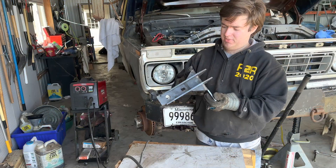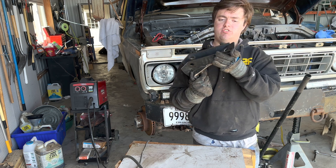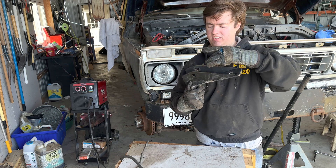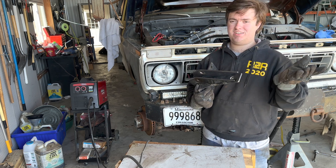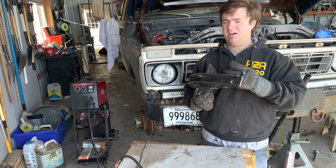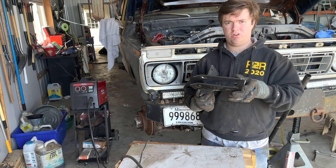Here's the bracket I just took off the frame — this is what we're working with. You may notice it doesn't look perfectly straight; that's okay, each truck is unique, and this is where my axle lined up perfectly. These welds need to be really good, because if they fail the axle is essentially just going to move all around and go out of control. For the first 500 miles or so, I'll be looking it over carefully, making sure none of the welds have cracked, and I'll maybe drive through some rough terrain to really test them out, because this will be under a lot of tension, torsion, and force.